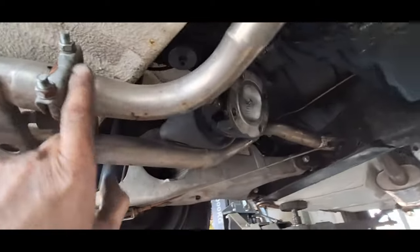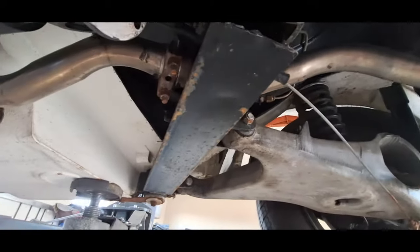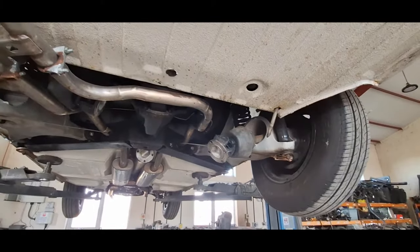There's a little bracket here, a clamp here. I assemble this exhaust dry and I don't over-tighten these - if you over-tighten them you get like an olive effect in the pipe. That shouldn't be there because I didn't do it. There may be some swearing - I'll edit that out.